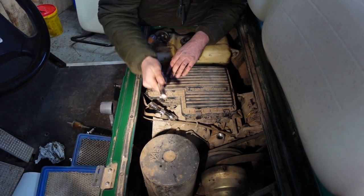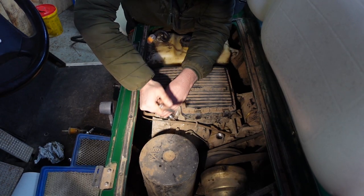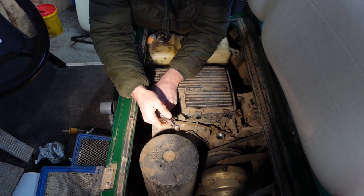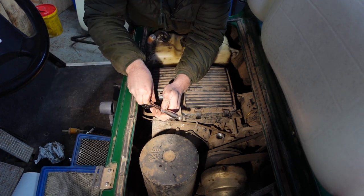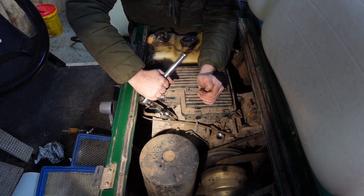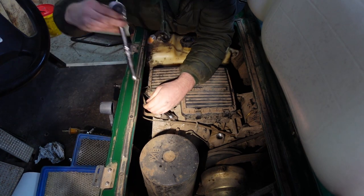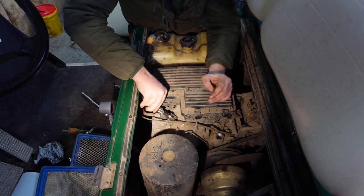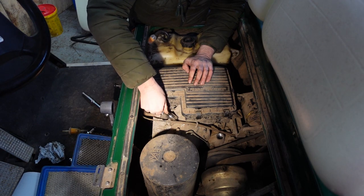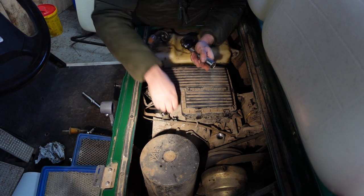And then really, if the spark plug has been put in properly, it's probably about a quarter turn to break the seal. And then once that's been done, it should literally unscrew by hand. Let's see. Yeah, that's it. That's nice and steady. Well, I'm presuming that the spark plug should be pretty clean. I know this machine's been stood for a while. That's why we're changing everything in it before we try and get it fired up properly.